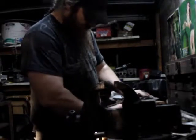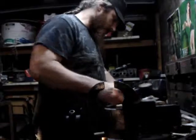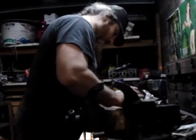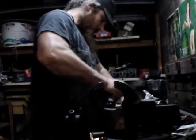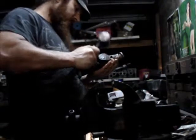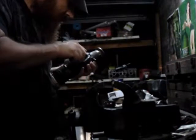And we'll set it back up on these little bars I got. This time it isn't so damn critical how I line them up. Just, that one is started in there, so I want to get this one going too. And they will just go into the hole for you and start on the ends of the U-joint. And what you do after that, drive her over just a hair, so you can take one of your snap rings and get it in there.